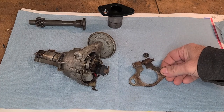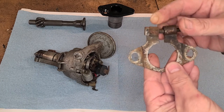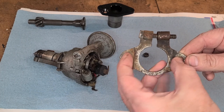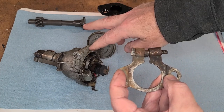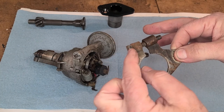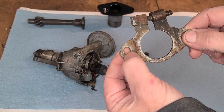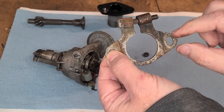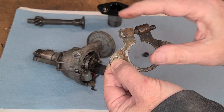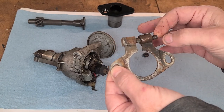As removed, you can see there's a lot of predictable wear. This retaining plate is what you loosen and tighten to adjust the distributor timing by turning it. The design is that you bolt it in place and then open and close this to allow the distributor to turn. You can see it's been over-tightened — that bolt is bent and the flange here has become deformed. You need to leave one bolt hole loose so you can make this adjustment, then tighten both once you get it set. We're going to head to the hardware store and find a new square head bolt for this.